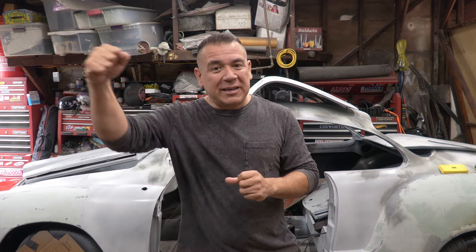You're bound to miss some spots of dents in the car that you didn't fix in metalwork, or that you're going to address with body filler now. But this is the time to do it — look for all those dents. Look at the car in different light, look at the light coming from different angles. I found spots on the rear fender that I didn't even know existed until the sun was setting and it hit the car just right — I found two more dents. Once you paint that car, you're going to be looking at those dents forever. So take your time, look at every part from multiple angles, move the light around, and look for all the dents. Get them covered with body filler or metalwork and move on.